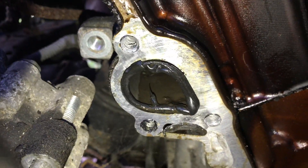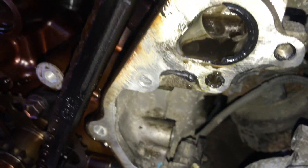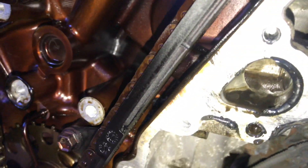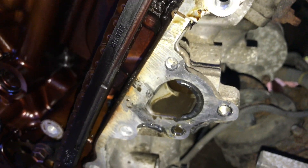Would that cause an engine to fail? I don't think so — the cams were turning freely. But look at this: pulled the cover off and there's this weird seal. Is this a rubber seal or silicone RTV that someone put in, or do you actually buy these? But look — it's missing there, and you can see there's evidence of water and oil mixing. So this seal was broken and missing parts of it. If that seal was also broken or if there's anywhere for water to get through, it could mix in with the oil. Maybe that's part of what happened, but I'm assuming now that it's just totally a head gasket problem.